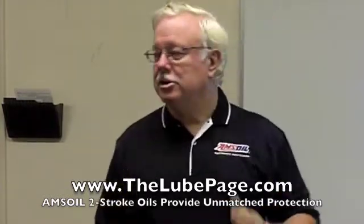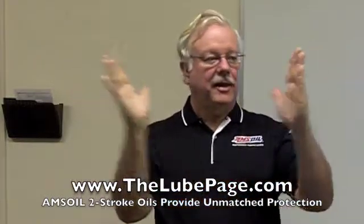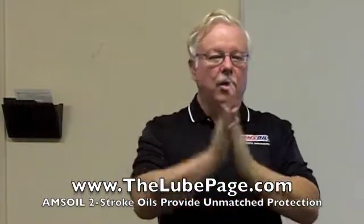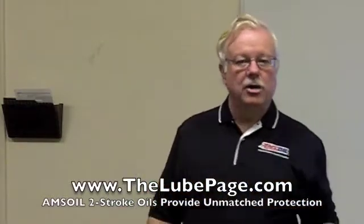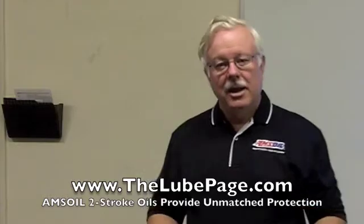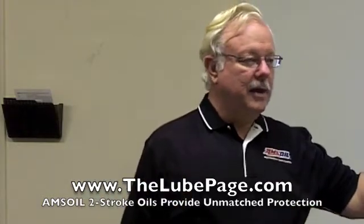And what those polymers do is they get on the surface of the metal, and when the two pieces of metal come together, they hit polymer to polymer, and they don't go metal to metal, and they don't stick. But the great thing about the polymers are, the ones that aren't stuck on the surface of the metal, that are out in the open in the combustion process, they burn just like that. And they leave no ash.